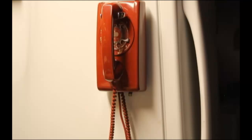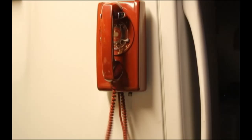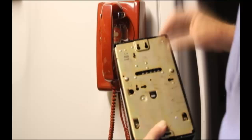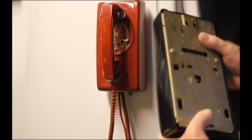This one is not modular — it's hardwired, meaning that the coiled cord, handset cord, and the line cord are hardwired. If you want to mount it, it won't fit on a wall plate with a modular jack sticking out. You'll have to line up with a piece of paper, mark these two holes and these holes here, mark it with appropriate screws, screw them in where marked, and just slide it down. The head of the screw goes in the wider round area and then you slide it down, and it'll mount that way.